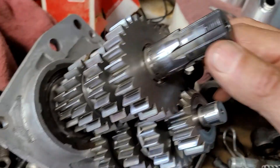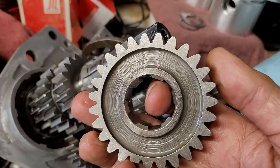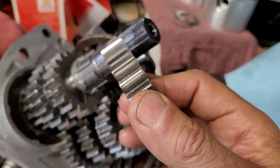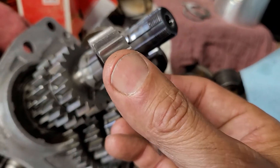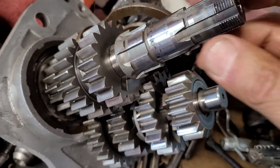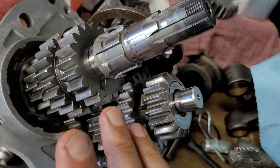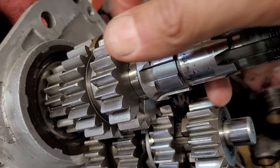Since we're going to be replacing the main shaft and probably quite a few gears, we're going to be replacing this too. This is your low gear — they're almost always in good shape. You can see it's had a little bit of metal go through it at one time, but it's clean, it's reusable. We'll most likely switch the whole gear set out to Andrews shafts.